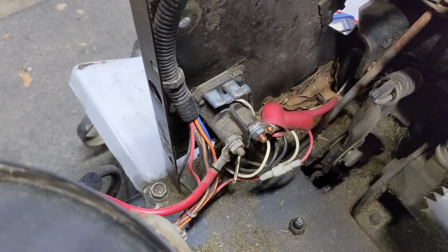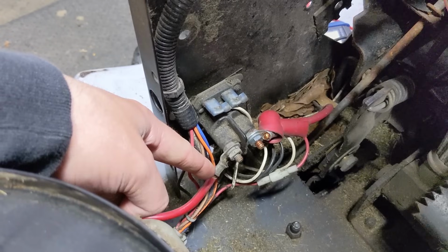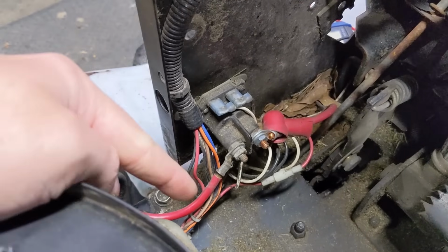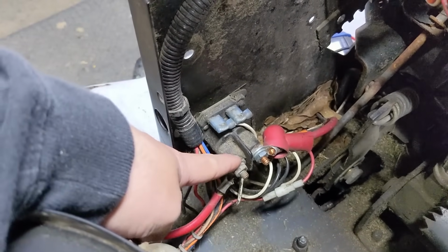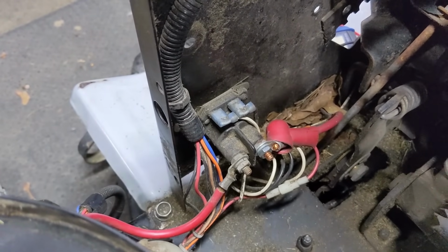And to prove that, we just did that simple 12-volt test to see if we were getting 12 volts or more at the starter wire, because we know we're getting 12 volts there and we can hear the solenoid clicking, and we're not getting anything at the starter wire. You guys saw 0 volts, which means this thing is just so filled with corrosion that the bar or rod that rises to make that connection simply cannot make the connection.